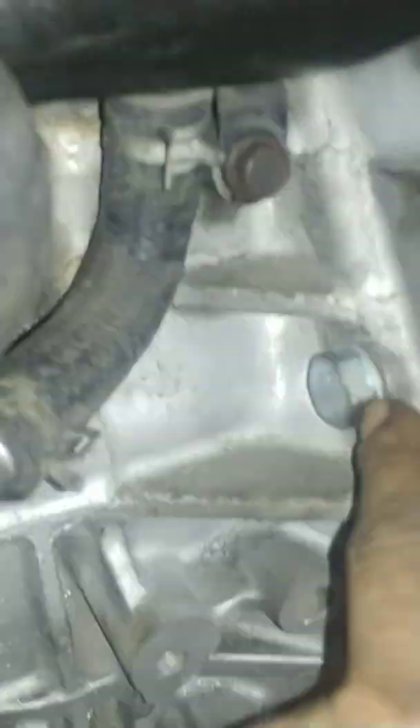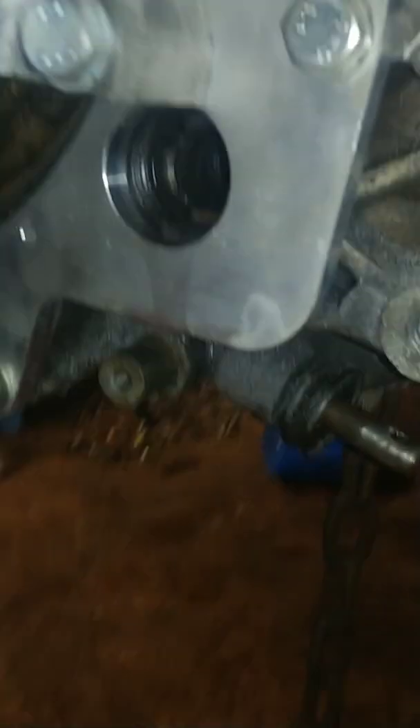So this is H to B. This is all flush, like I said. You got to put these bolts in here, these bolts in here, your T bracket will go through here and bolt here and here. I just drained the fluid — he had some, I don't know what he had in it, it's red, looks like it's automatic — but you got to run manual Honda transmission fluid in these. You can run whatever you want, but I recommend the Honda manual transmission fluid. I've always ran it, and everyone I know has always ran it and had good luck.